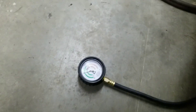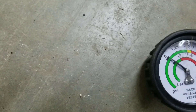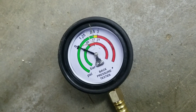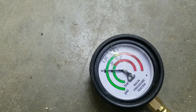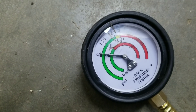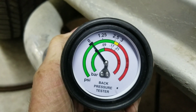I have the sensor in the vehicle and there's the gauge sticking out from under the truck. I'm going to start this up. I'm running and I have essentially no back pressure, which is surprising — I expected it to be plugged. There is essentially no back pressure there. I'm just going to verify my hose is still on, and if it is, I guess I'm chasing a ghost.